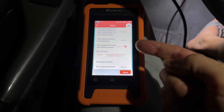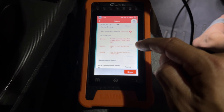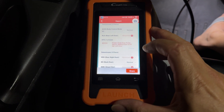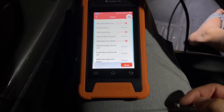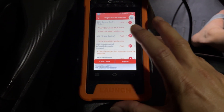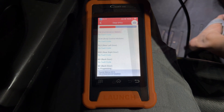There's a supplemental restraint code — passenger airbag mode indicator. A combination meter code showing it lost communications with the Navi — I think that was when I swapped out the module for CarPlay. And a power seat malfunction. None of these are current faults, so I can go back and just clear everything — clear all the codes and it'll clear it all out from the system.